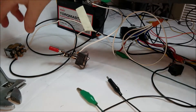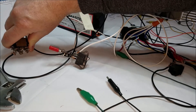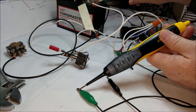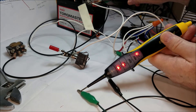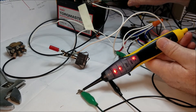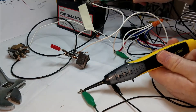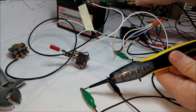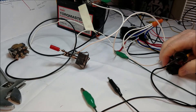You turned on the power and now you're driving along. It reaches 180 degrees, so the PCM kicks on the fan — click it on. This thing clicks on. Now we know the power wire going to the fan at 180 degrees is on. Say the temperature drops — the computer clicks it off, and you've got nothing. Here's the second fan — nothing yet. It reaches 200 degrees, clicks on, and now you've got power.